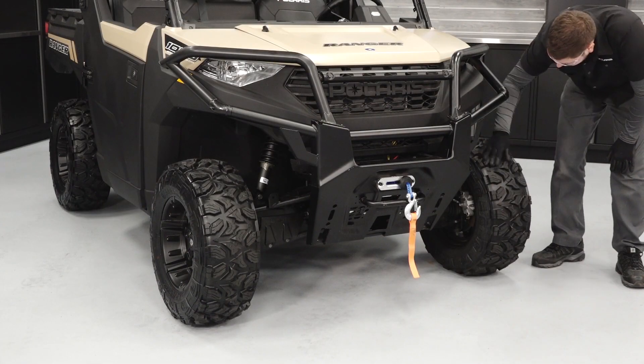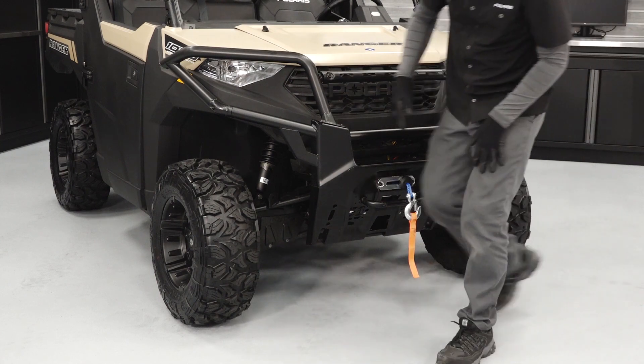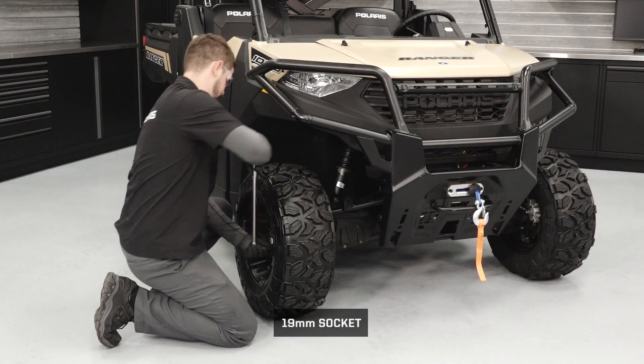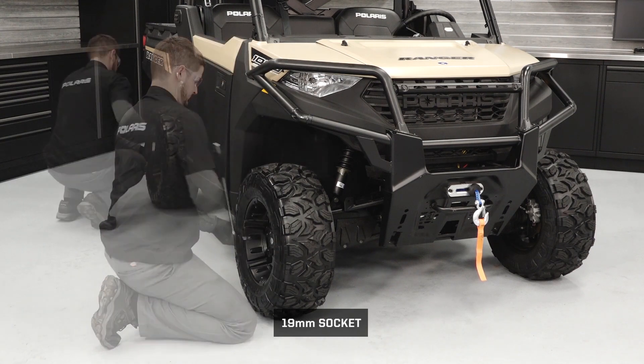Lastly, take a close look at how the tires are wearing. If there is irregular wear, it may be time for a rotation. To remove the tires, start by loosening the lug nuts before the vehicle is off the ground, but do not remove them.